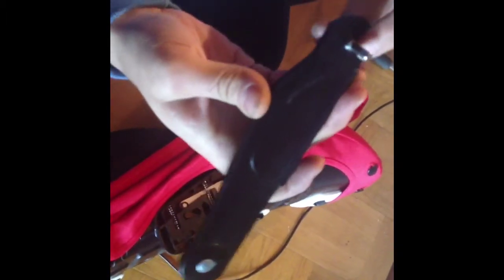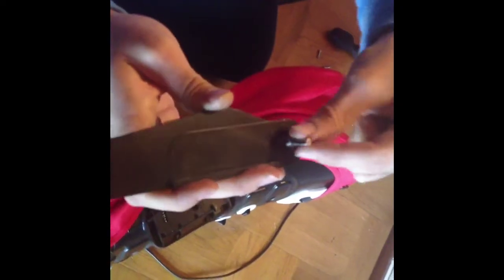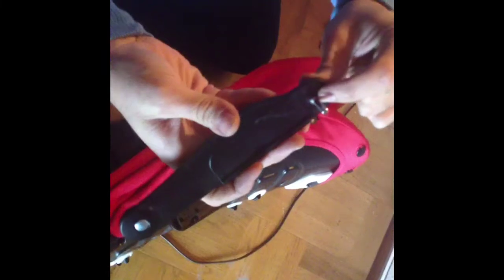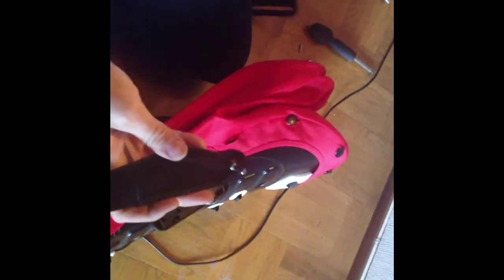There is a small groove here that can erode a bit. I'm going to use a sander — sometimes you can use some kind of a pinching cutting tool — but don't damage this pin too much or you'll be in trouble because it's not just a screw. I'm going to make it a little bit deeper and then we're going to put a new washer or stopper there so that it is tightly attached inside this groove. I've corrected the groove using my Dremel on this pin.